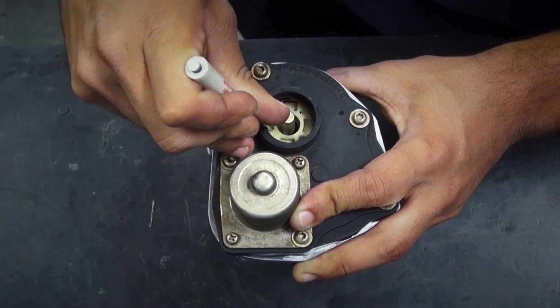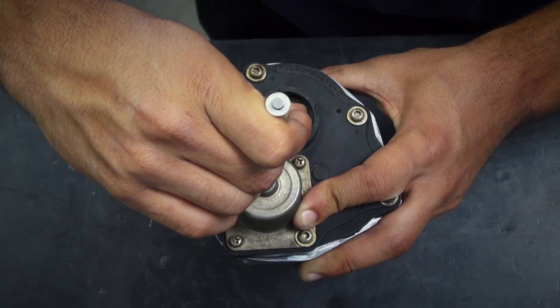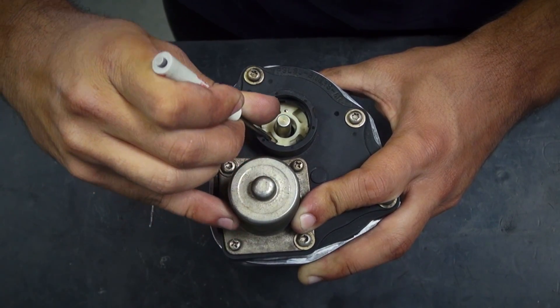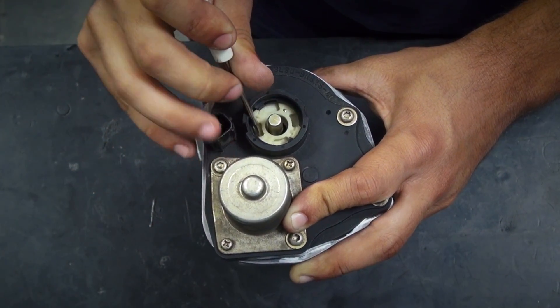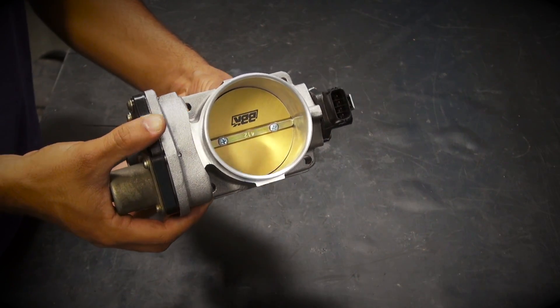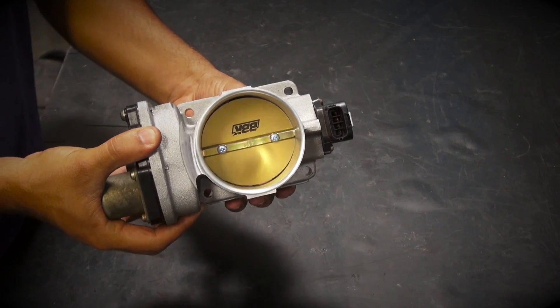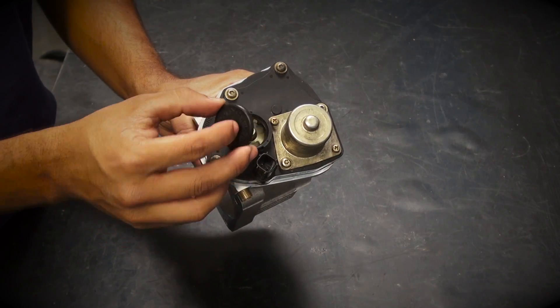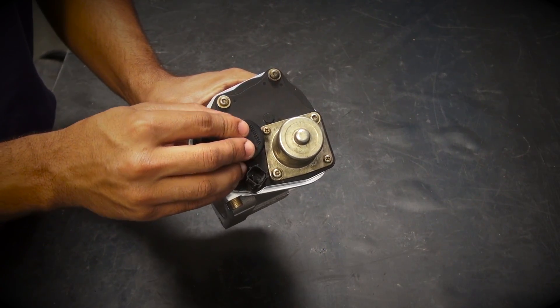To make these tabs line up with their respective landings, rotate the plastic cap counterclockwise and then gently lift the cap to allow the tabs to lock into place in the landings. You will know that your spring is properly wound by opening the throttle blade by hand and then releasing it — the blade will snap closed when released. Now you can snap the dust cover back onto the motor housing.